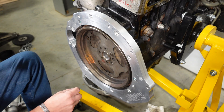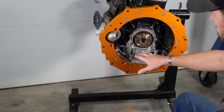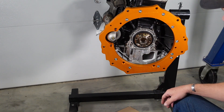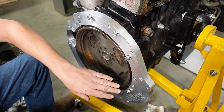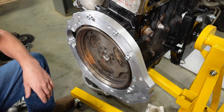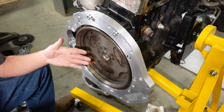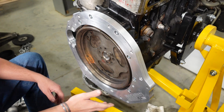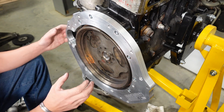For the rest of the adapter plate installation, you'll put your socket head cap screws in here. I've got the rear sump pan on this engine and the whole pattern added, which gives you 10 total fasteners to join the adapter plate to the block. Follow your written instructions and apply blue Loctite or medium-strength thread locker to all of these. I'm not going to do the lubrication and Loctite in this video because this is just a mock-up — I will not call out torque specs since this is a generic video for all of my 6-aught series adapters. All your bolts are Loctited, installed, and torqued while the Loctite is still wet. Now we're ready to mount up our starter.